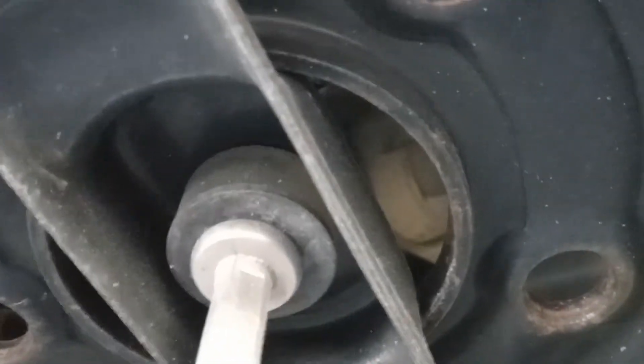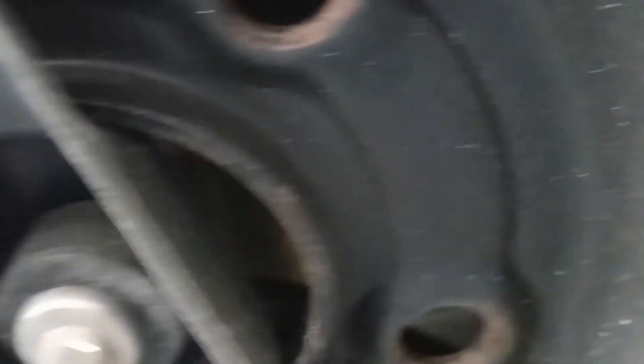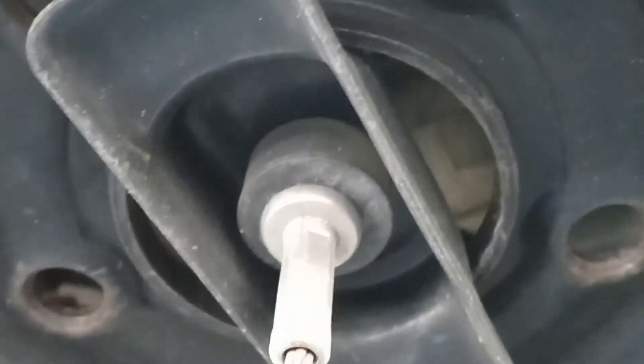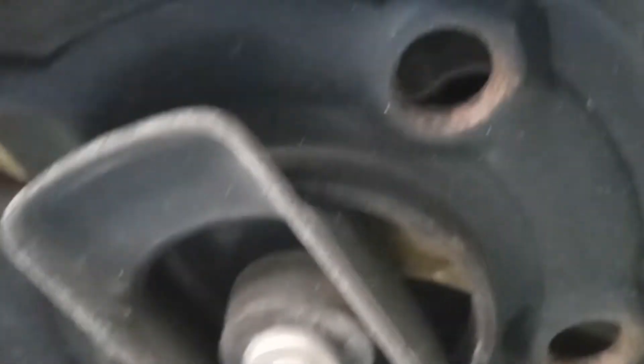Then you feed the T through the center — I'll show you that. If we can get under here, you can see there's a little T right there. Once the tire's down, you have to feed that through the center and it'll release the spare tire. That's how it's done. Joe Beermaster — thanks for watching, please subscribe and give me a thumbs up, hope this helped.